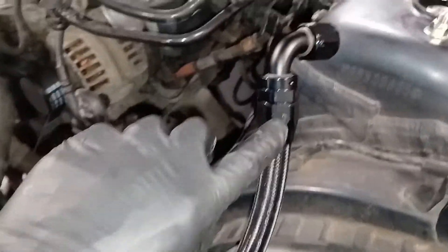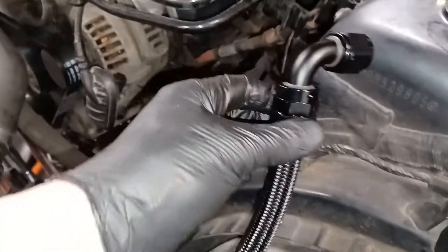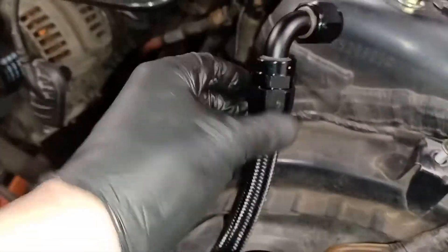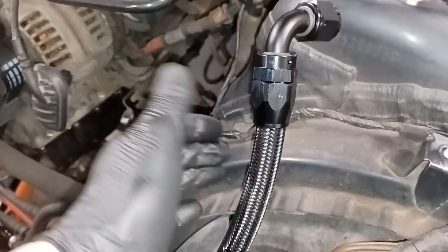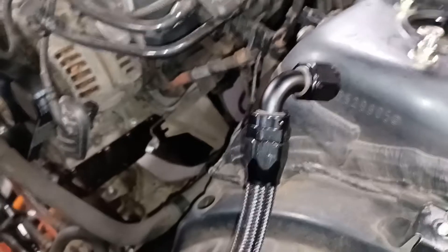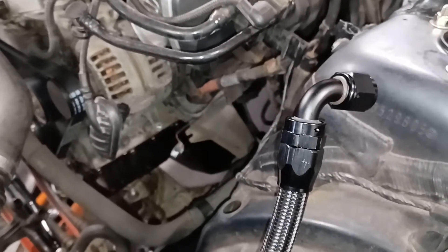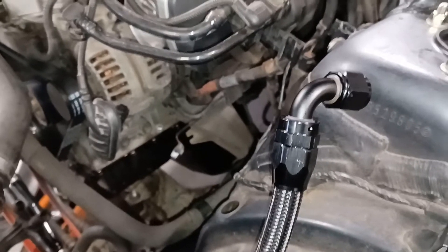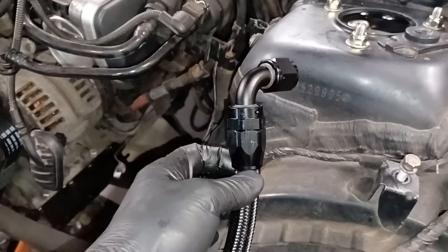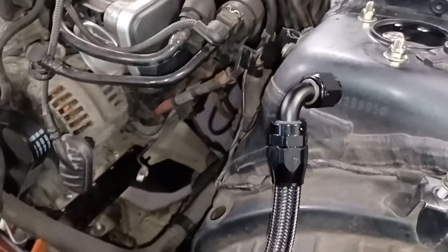The other thing I was going to say is that you have to slide this outer part over the pipe first, then the pipe butts up against a ridge inside the outer piece. When you do it, it tries to fray the end of the pipe because it has steel braiding on the outside - very painful, as you can see what it's done to my gloves. Try to do it in one go; I used a screwdriver to gradually ease it in all the way around. Don't pull it off and retry or you'll fray the end more.